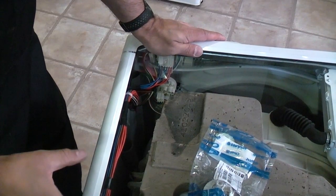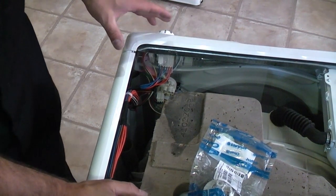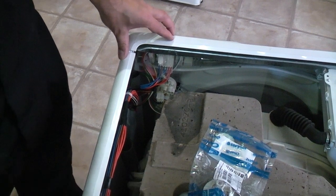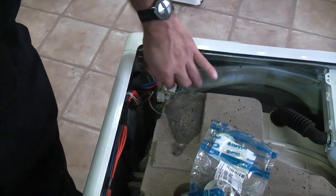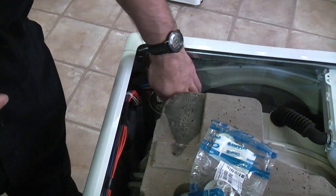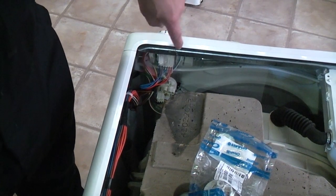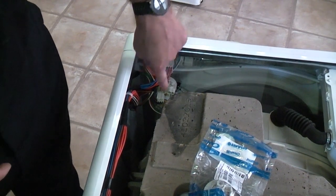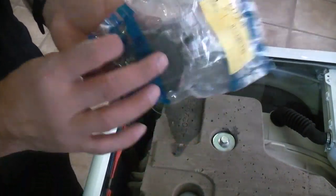This can cause several problems with the machine and it's not always easy to identify the problem. I'm no expert on diagnosing faults with washing machines, but we've actually tried blowing down the pipe which goes to the bottom of the drum and that hasn't worked. So the next course of action is to change the pressure switch. This one costs about £20 delivered.